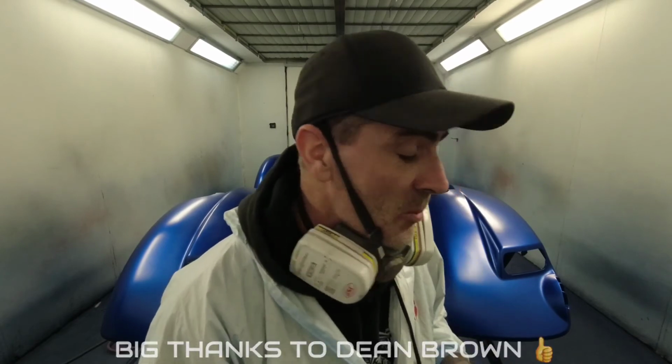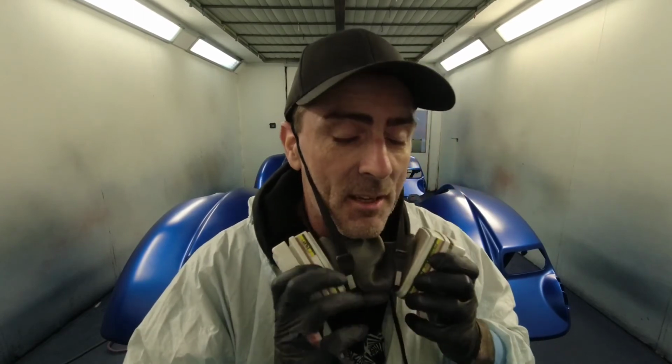Ready for the first drop of clear. I've got the gun set up, running 2 bar pressure. I'm running the GTI Pro with the TE20 cap. Dean gave it to me, so we're going to give it a try. So I'll see you in a bit.